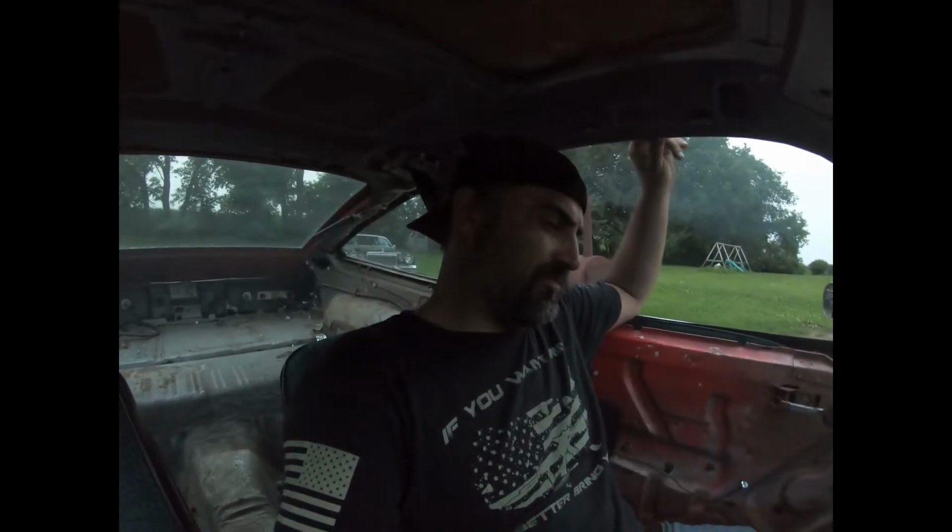I still heard a little bit of a rattle on this thing up in the high RPMs there. I don't care for it. We're at, like I said, 20 degrees total timing right now. We might have to pull a couple more degrees out of it yet too. Anyway, thanks for watching, guys.